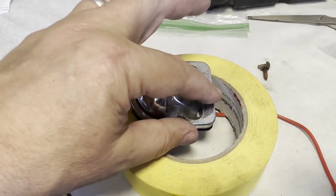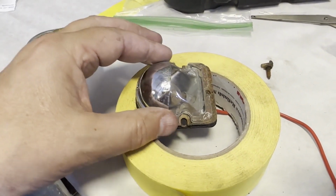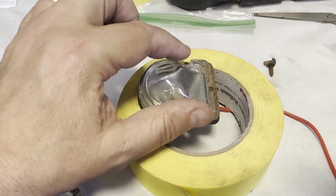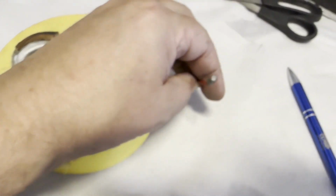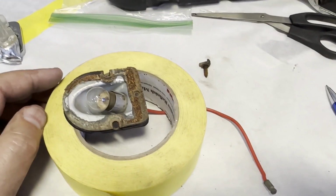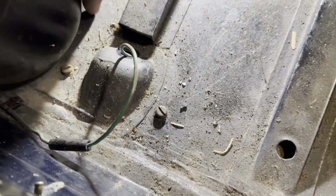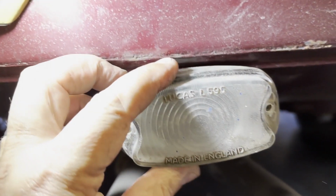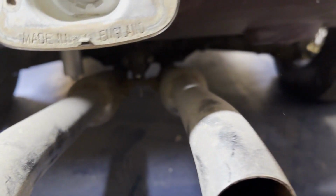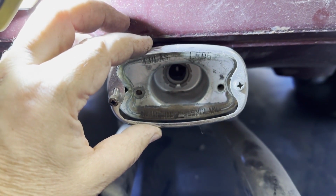Okay, so let's take it apart. So you take the screw out here, this comes off, this will then pull away. Under the 2 screws, this will then come off, and then this will come out, and there's only 1 wire connecting that. Just looking at the reverse light, the housing unbolts with 2 bolts inside the boot. That will release the housing, and the wiring is obviously here. And then we come to here, and we have the cover go on there, and then there's just 2 bolts holding that on top of the cover to hold that in place.